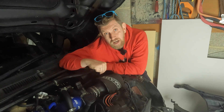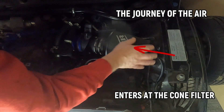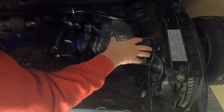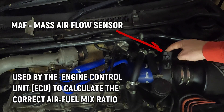This is a relatively cheap upgrade for the Mark 1 to give you some more performance, but it is going to be hampered slightly by the warmth of the air entering the filter. In my opinion, if you are looking for a massive increase in horsepower you are likely to be disappointed. A great whoosh sound and more turbo noise from the engine breathing easier - yes - and a faster response time as the airflow restriction is improved, but more actual power? I'm not so sure. So what can you do to improve the coldness of the air getting into the engine? Air is going to enter the cone filter here in the engine bay, and the filter is sponge-covered, removing debris while allowing clean, cold air to enter.